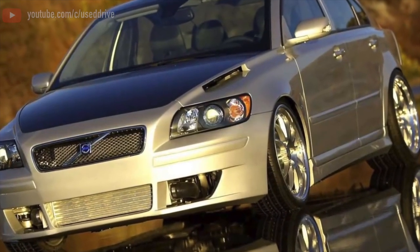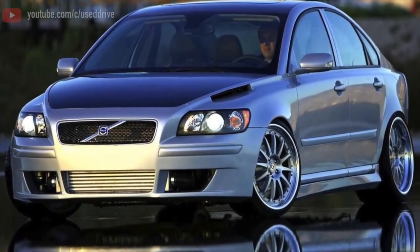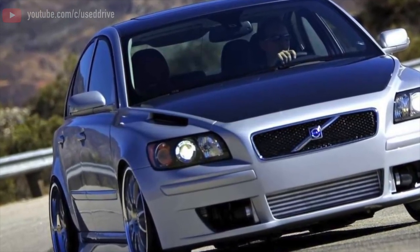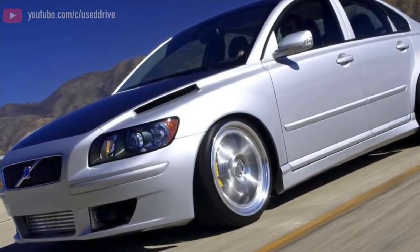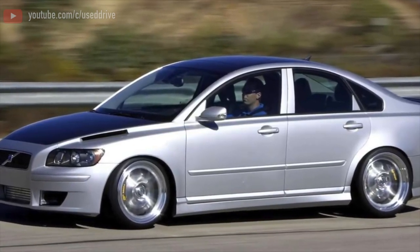In most cars, manual transmissions do not give cause for frustration. This is not the case with the first-generation Volvo S40. The problem is the same as that of the soft-platform Mitsubishi Charisma — a box from Renault. The M3P box with 1.6-liter engines and the M5P box with naturally aspirated 1.8 and 2.0-liter engines and a diesel engine are both a kind of French-made JB3-JB5 boxes.